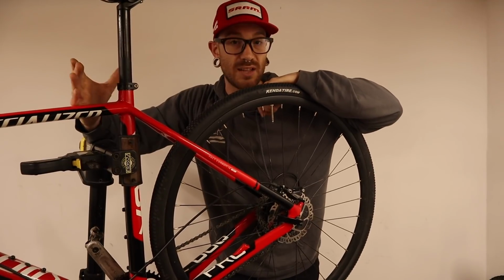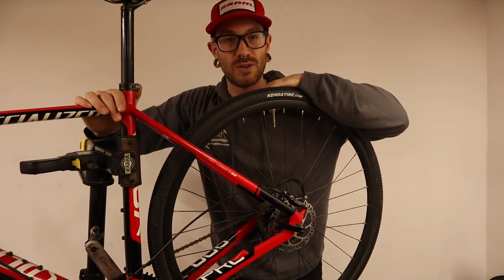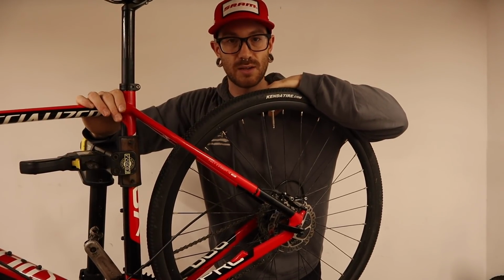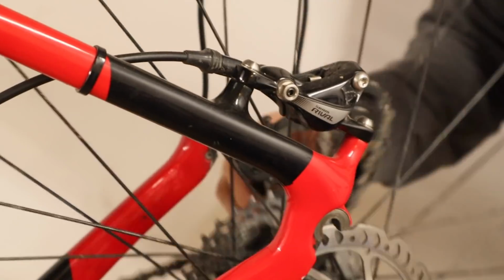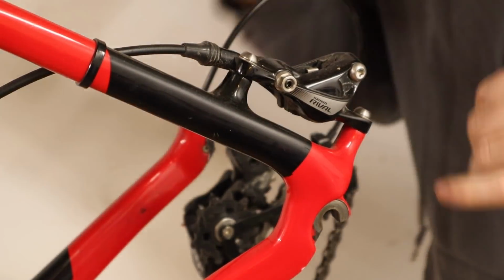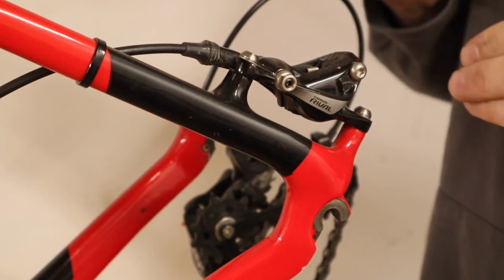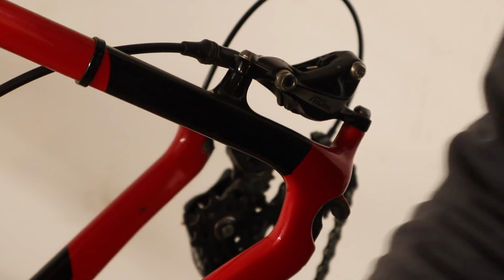I really only get one chance to try. If it doesn't work, then I throw my hands up. That's not the case though. I'm trying to do this as a hack job here in the shop, with it hopefully working at the end and not losing a lot of brake fluid, because I don't have anything to bleed brakes with. So the first thing I want to do is try and get this angle of entry here at the caliper to at least be somewhat close. And because I'm going to have to open some of this stuff up and anticipate some fluid coming out, I really don't want any rotors or brake pads in there at all, because contamination is bad.